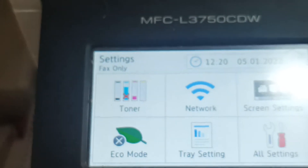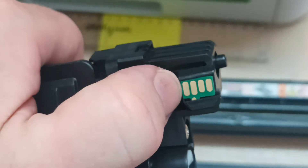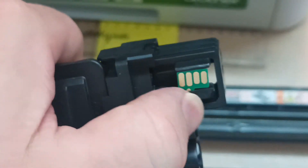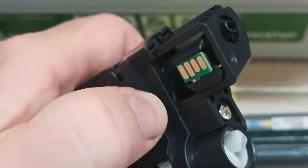All is not lost — there's still plenty of toner in the blue cartridge, so you don't have to replace it. Simply find an old empty blue toner cartridge, undo that screw, slide it off, remove the microchip, and put on an old or new microchip. Problem solved. Hope that helps — thanks for watching.